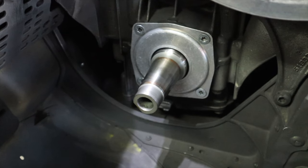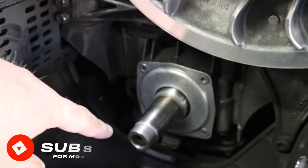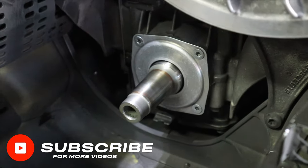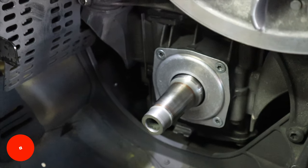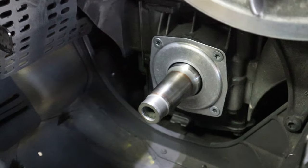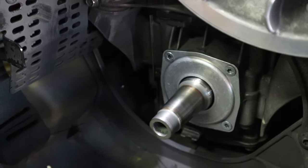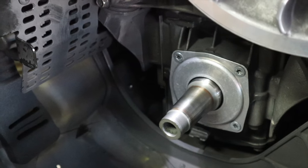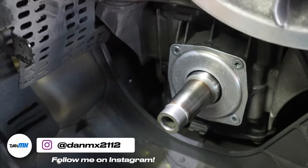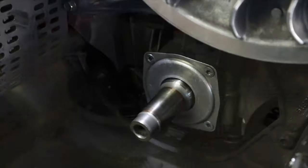I want to point something out while I've got this exposed here. Once you guys get your clutch out, if you've got any rust or anything there, that's going to cause an issue — maybe the clutch is seized on there a little bit. Take yourself some Scotch-Brite and just clean up that crankshaft a little bit. That will allow you to put this back on and avoid that seizing up. What I do too is Scotch-Brite it and then coat it with WD-40 to give it a barrier.